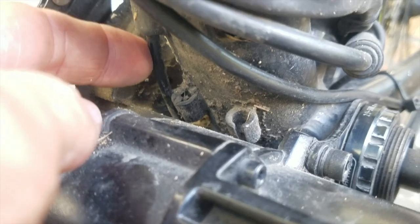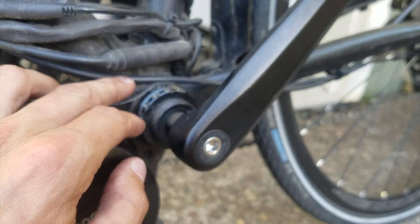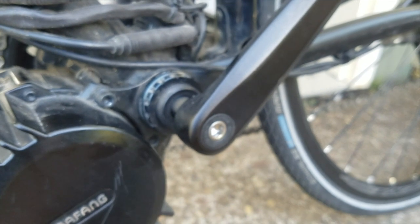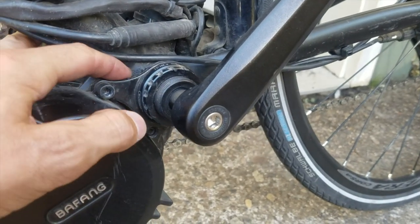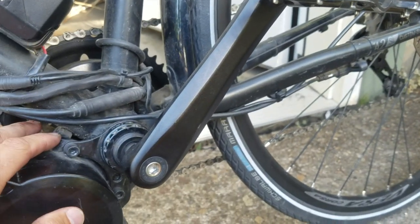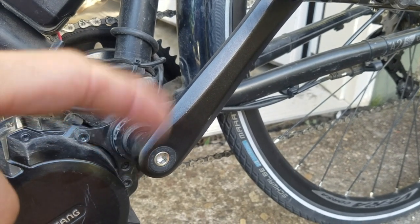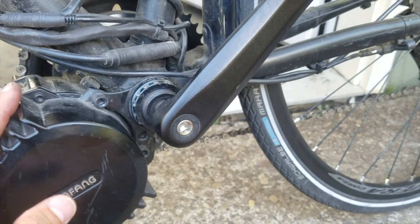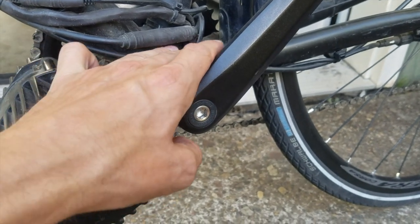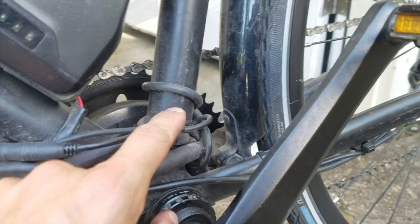The issue with hydraulic brake lines is that if the line runs under the motor, the caliper is not going to fit through that gap, so you'd have to either remove the caliper or remove the lever, and then you'd have to re-bleed the whole system. Reroute your hydraulic lines so they're easy to replace without having to undo the motor. I'd also advise against wrapping cables up tightly around the tube.